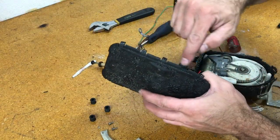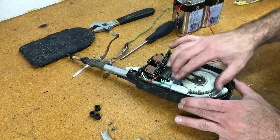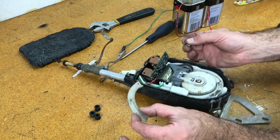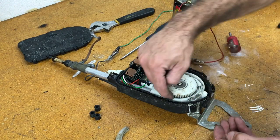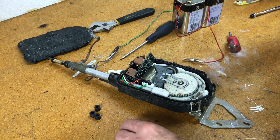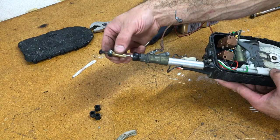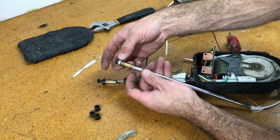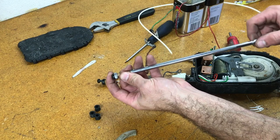So what I did was I removed the top cover, just basically prying off on all these little plastic tabs. Then these three rubber grommets are very important for spacing out the motor in its actual plastic casing. These two screws accompany a hold-down plastic piece that goes over the actual gear mechanism that basically holds the antenna gear in place so that when it comes back down and back up, it feeds it into the gear set. And I had to articulate the actual antenna just a tiny bit to remove this grommet. The new antenna I bought has a black top but a chrome grommet — I'm not a huge fan of the chrome grommet, but I might just have to live with it.